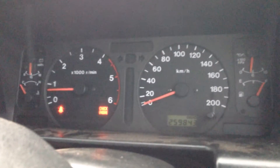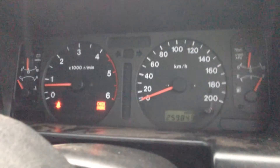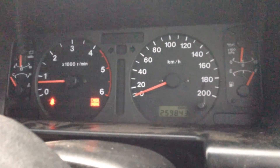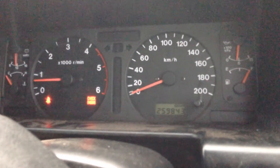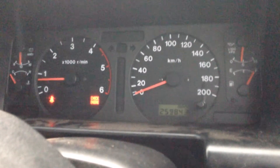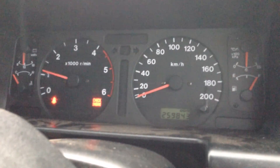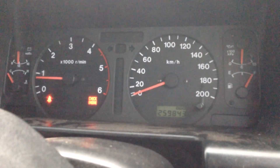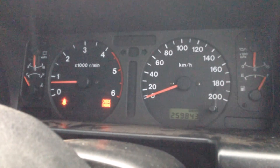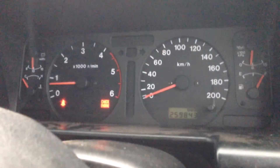Basically, all I've done is wait for the glow indication to stop, then waited another five to ten seconds - about five seconds after the airbag light stopped flashing. I cranked it, it didn't start straight away, so I stopped, turned the ignition off, went back on again, and away we go. Now we're sitting here idling nicely with throttle response. That's probably my tip for getting one of these engines started on a cold morning.